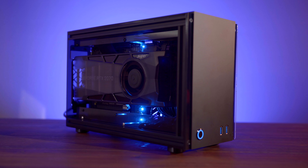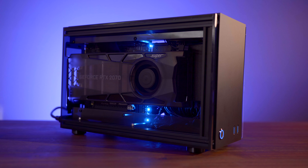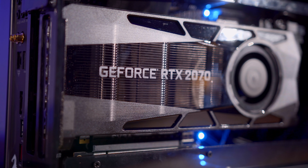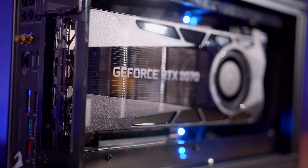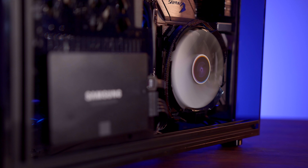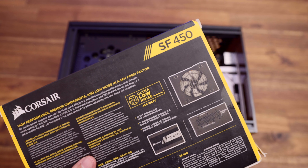As the title would suggest, I went with an RTX 2070 Super for the GPU. This particular 2070 Super is the EVGA blower model, and while I much prefer open air style coolers because they generally perform better and run quieter, this blower style allows hot air to be ejected outside the case instead of ambiently flowing throughout this tiny little case. Whenever you're working in a really small form factor Mini ITX case like this one, it's usually a better idea to go with a blower style card so that you aren't passing on the heat from the GPU to all the other components in the build. For storage, we have a 500 gigabyte Samsung 860 EVO, and for cooling the i5-9400, we have the CryoRig C7 CPU cooler. Finally, our power supply is an SFX unit — the Corsair SF450.